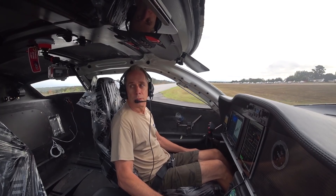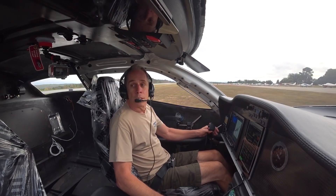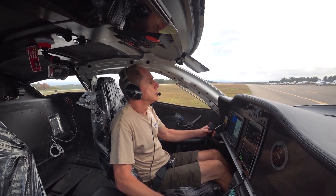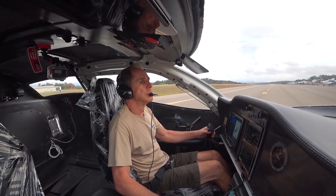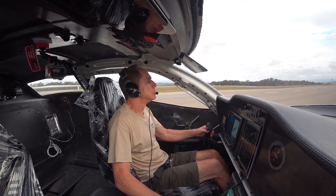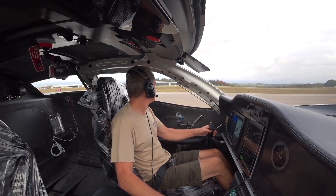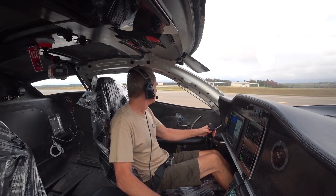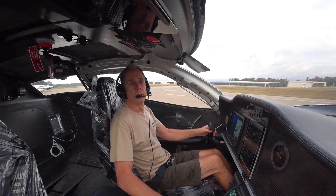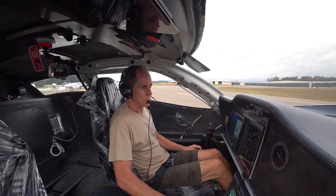I may have to go back to using the lower pressure on the fuel pump. I spent quite a bit of time working on trying to solve this problem — Saturday doing runs and analyzing data, then Sunday morning doing some runs, then analyzing data and more runs in the afternoon — just trying to figure out what's going on. When I run it up to a higher power setting where it goes into higher fuel pressure, it's like the injectors are cutting off and the engine just starts quitting. That runs up the pressure on the fuel rail and everything cascades back to idle.